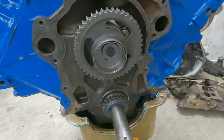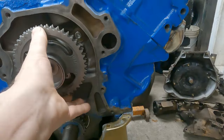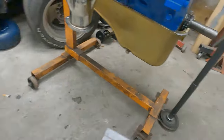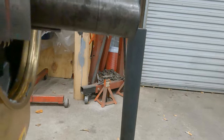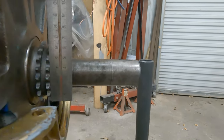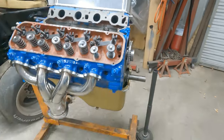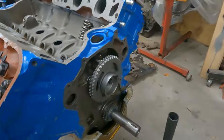That's what I'm working with, that's what I got going on. Now — no more scrubbing, no more rubbing. Got a little slack. Cam gears are in line. That's dead nuts — perfectly square with the rest. Doesn't have any more problems. Should be able to put the timing cover back on once I degree the cam.